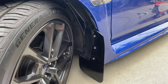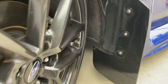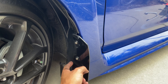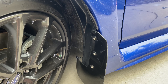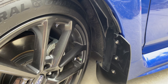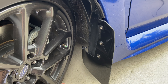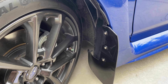I lined it up to my liking, tightened everything up, and put the pop clip back. When you tighten these up, just tighten them snug — don't distort the washers or the mudflap, just snug is fine, it'll hold. The good thing about these front ones is they're really easy — you don't have to take the wheels off. If you ever need to adjust them, just turn the wheel, get your Phillips head screwdriver out, and adjust everything.